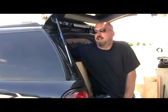I was really hoping to see maybe my fuel trims off a little bit. That was my theory as to why the mileage tanks. My theory was the PCM is going to slightly increase injector on time to compensate for the lack of fuel volume. Because like I said, that thing was so clogged, I'm surprised the truck even ran.